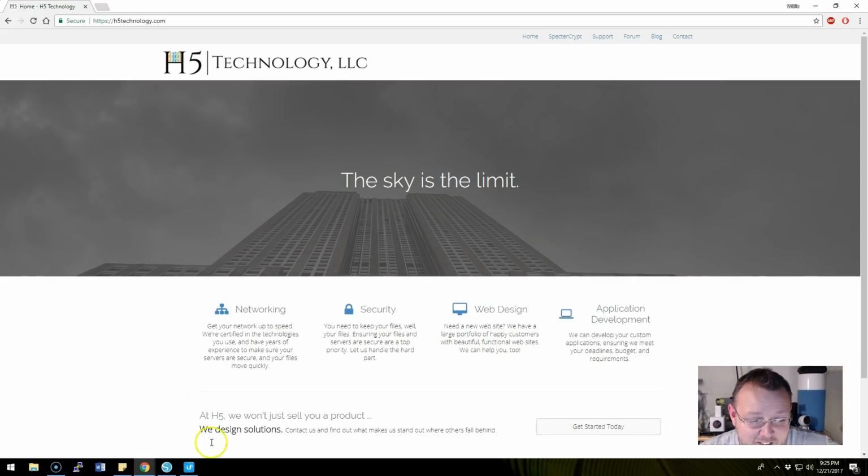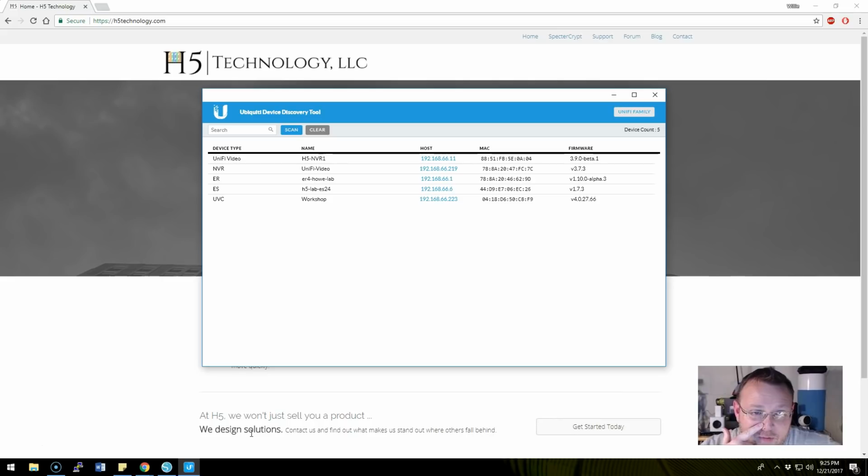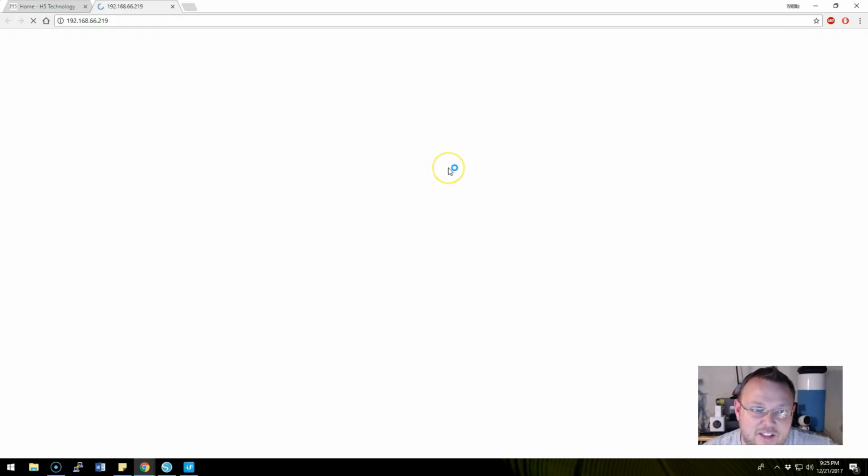So let's pull up the Ubiquiti device discovery tool, and we can see that this NVR is showing up as it's on 192.168.66.219, and it looks like it's running version 3.73. So let's click on this guy.